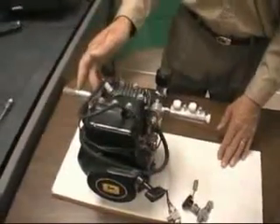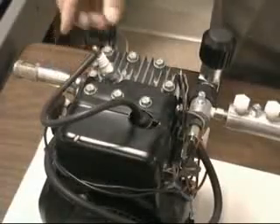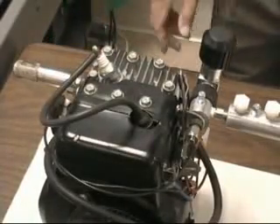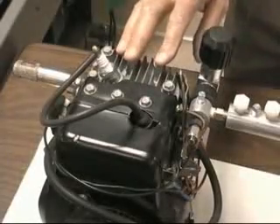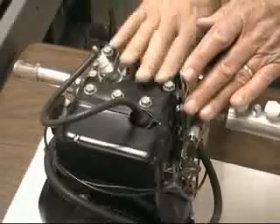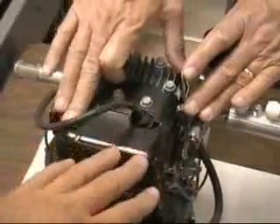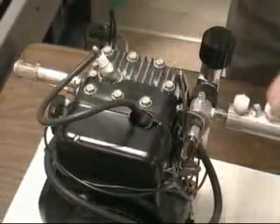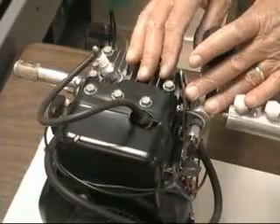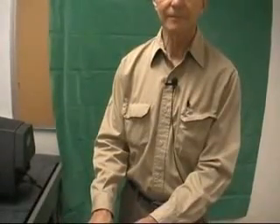You can do a delayed off for the flow of current to the coil and run this as a Kettering-type ignition with an external coil. Either way, you're going to have to change your timing on the engine to take full advantage of the hydrogen — timing to a later point, pretty close to top dead center. One such source for ignition control systems is Autotronics — A-U-T-O-T-R-O-N-I-C-S — and they are on the web. There are others as well.